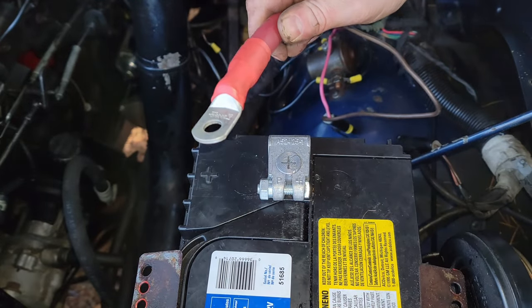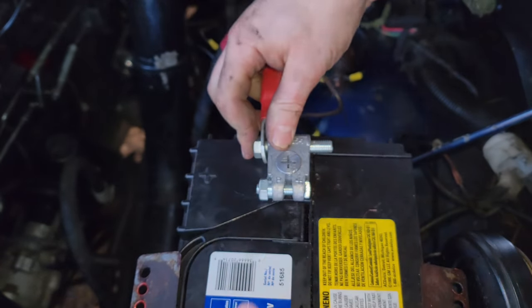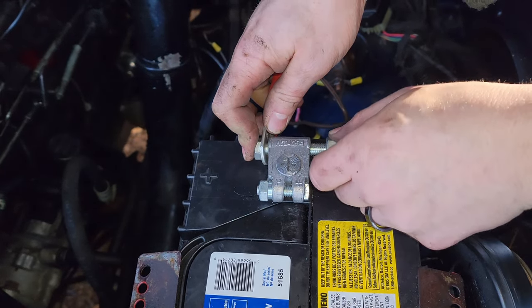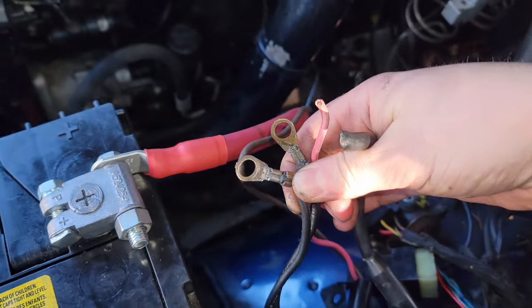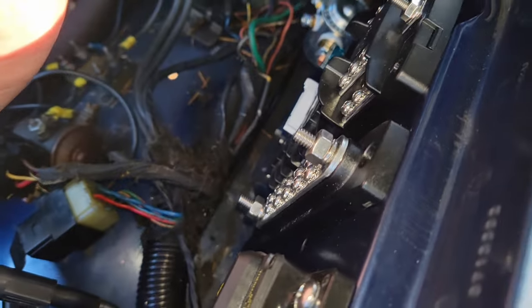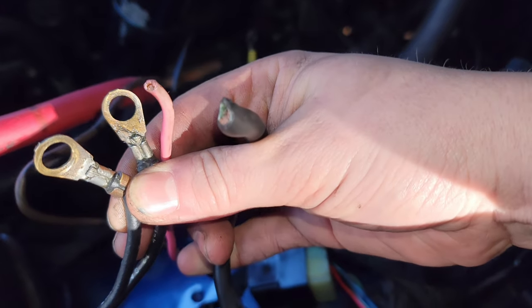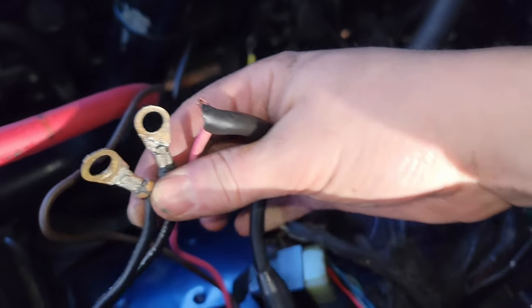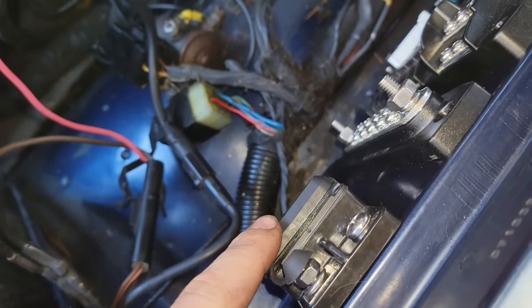I'm going to wire the starter cable onto the terminal for now, then show a couple of things for my new auxiliary fuse block setup. At this point I'm going to wire the factory wiring that was on the positive terminal over to the bus bar I just installed as part of my fuse block setup. The two wires to the grid heaters, the pink wire to the hazards, and the far wire to the fusible links are all going to get wired right to this bus bar, which will be after my circuit breaker.